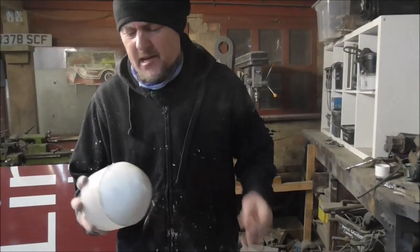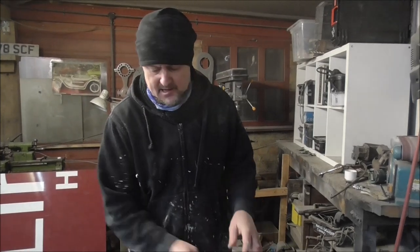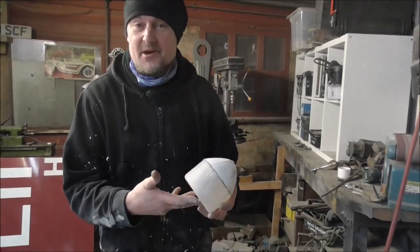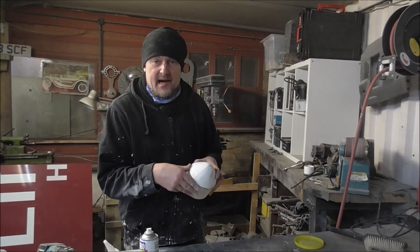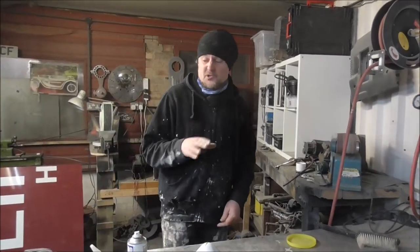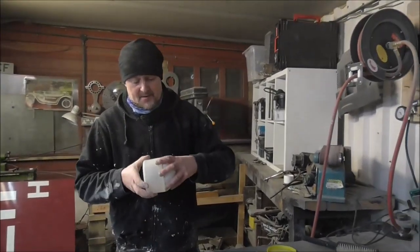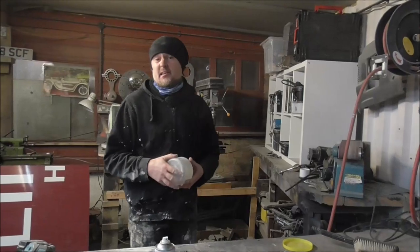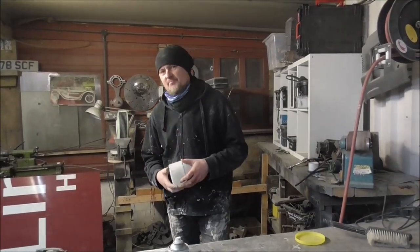That's glued on there. I'm going to give it 15-20 minutes so it's fully dry before I run the grinder around it. This sort of mitre bond or cyanoacrylate-based glue dries from the outside in - so even when it looks dry, it's not quite dry on the inside. Make sure it is dry before you grind. Also, grinding cyanoacrylate glues gives off a gas that will make your eyes run. Perhaps don't ever do any of that - just watch me take all the risks!